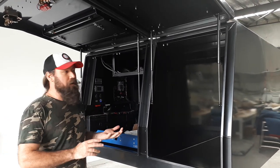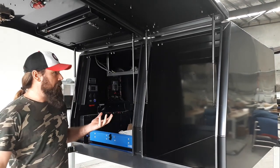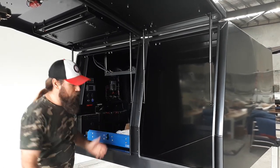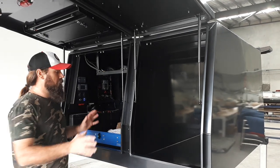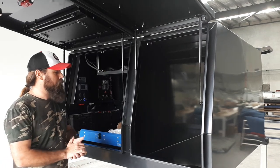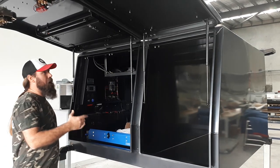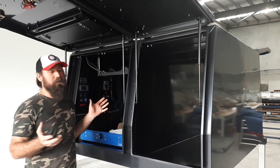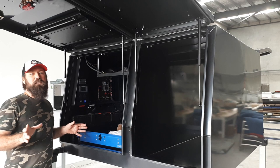The first thing is the frame. Your frame is a 50 by 50 by 3mm aluminium SHS. It is fully TIG welded internally. You've got a frame 50-50 underneath as well, runs with a 2.5mm floor. All riveted and sealed down to the framework. Then a skin with a 2.5mm sheet. Load rated to carry 600 kilos up top — it's been certified, whole works, so you know that you're right when you're carrying stuff with this canopy.